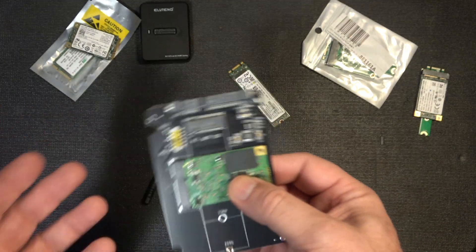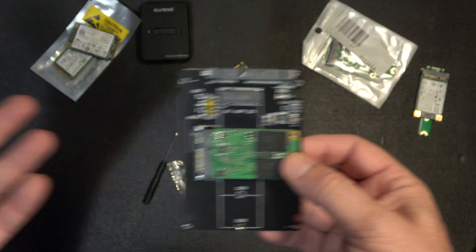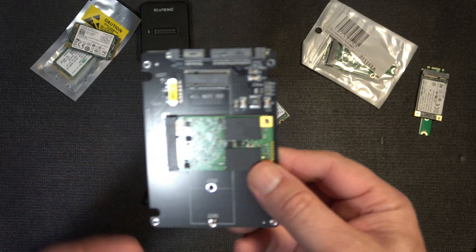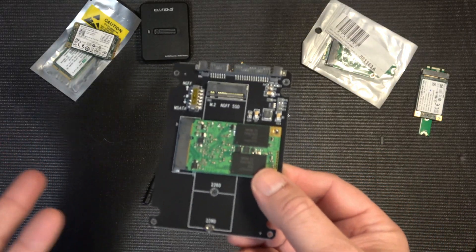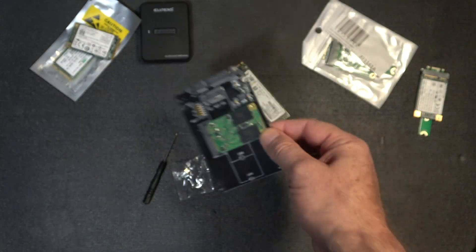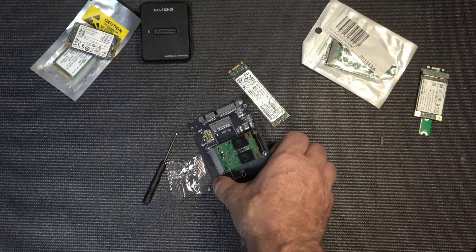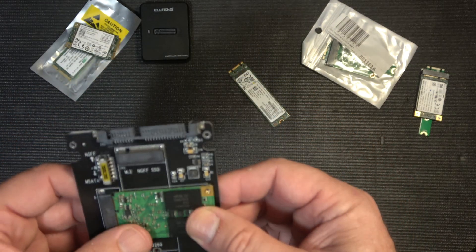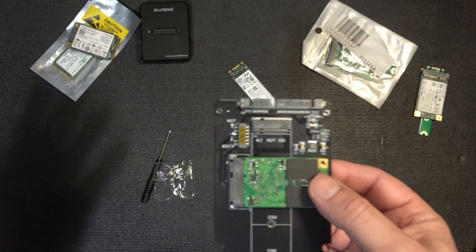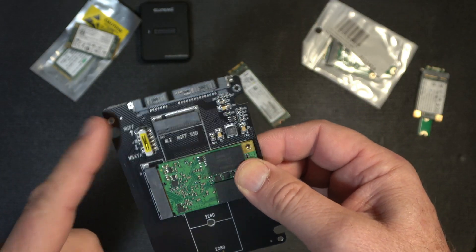This is what you do to fix the situation. I know this is probably common knowledge, but I put this video out just to make awareness that if you have these old drives kicking around, they're not garbage — they're solid state, they're still faster than a mechanical drive. So why waste them? This was maybe a seven-dollar part from AliExpress. I'll put a link down below because I really think this is a smart thing to do. Now I'm able to make use of some old hardware on older systems that I want to put an SSD into but don't have board support for it.